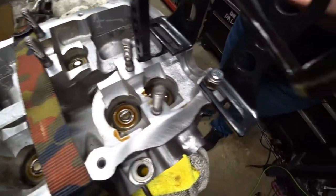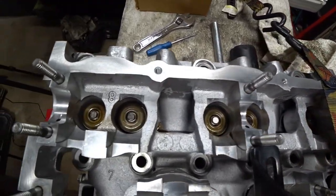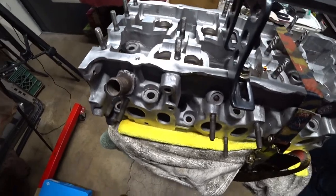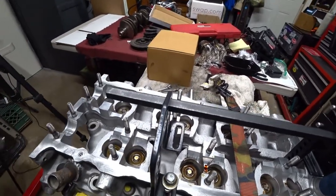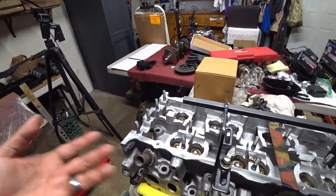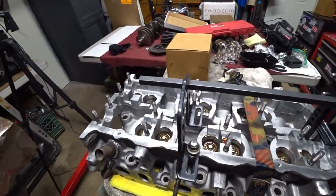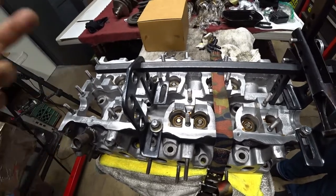So you guys can see, we went all the way across, we did six valves altogether. The other six are over here — we already did them. So right now the head is going to be on standby, because now we have a block to finish. 12-valve VR6s are really weird — you can't just assemble the entire head, let it sit, and then slap it on a built block. You have to build the block, slap on the head, and then time everything, because they use multiple chains to time. We can set the cams and put the locking tool, which we will end up doing — but that will be for the next video. We're done with assembling and installing your valves, all 12 intake and exhaust with springs, retainers, and keepers.